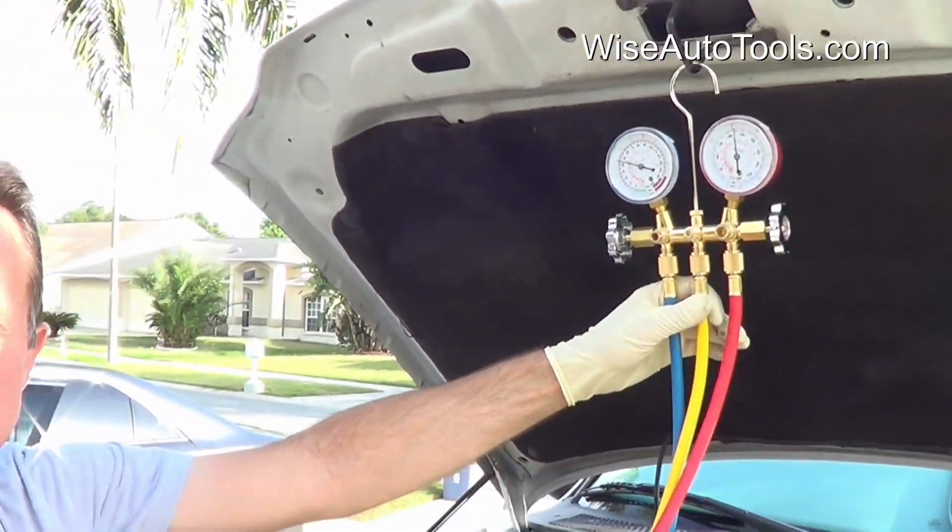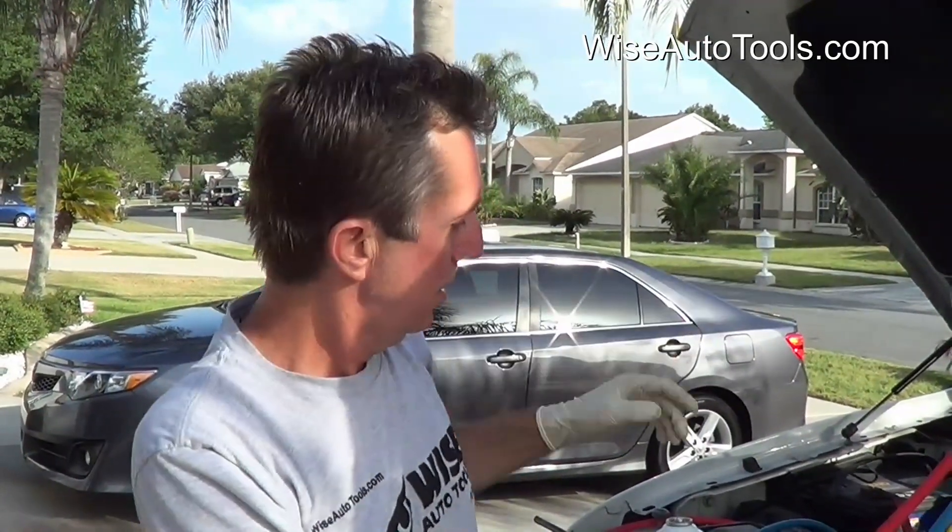The lowest I saw the low side go is about 40. This is one of those cases where adding more Freon may not necessarily be the right thing to do — if you add more Freon, those readings are just going to go up higher. Adding Freon when you don't need it is not going to be helpful, so we're going to do a little further looking before we decide to do anything. That's why it's good to have an AC gauge set and check the readings, rather than just buying a hose from the parts store that lets you add Freon with no idea what the readings are. Low refrigerant is one of the main causes of AC not cooling well, but that doesn't mean it's always the case.